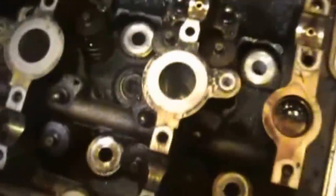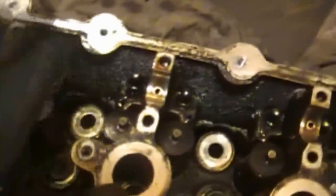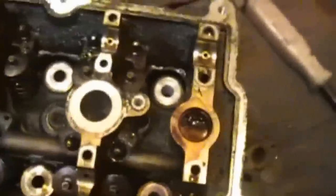Don't worry about all the EGR smog stuff on the back - you can work around it when you put your valve seals in. Also, the lifters stayed in when I turned the head upside down, so you might want to watch that. Don't let them fall out. If you can pull them out, pull them out; if they won't come out, just leave them in there. Be careful of your O2 sensors on these manifolds - I almost broke one. You might want to take it off, but if you're careful you can still take the manifold off. I put my parts on one side of the car and these parts on the other side so I know where everything is.